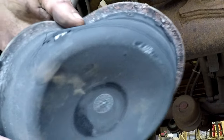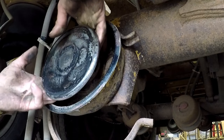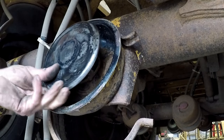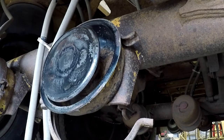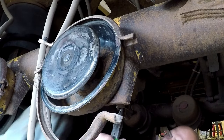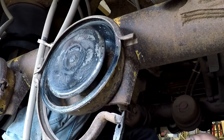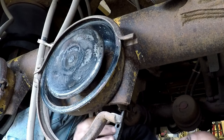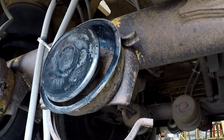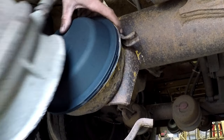There's your service brake diaphragm — you can see our hole in it right here. Check the spring behind the pad to make sure it's not broken, and it's not, so we're good to go ahead and replace this diaphragm. You will likely find it helpful to pull the slack adjuster back and put a pair of vise grips on the rod in order to keep the small return spring compressed — it will make it a lot easier when you reinstall.